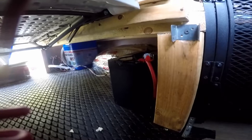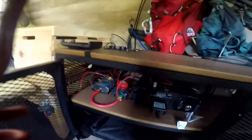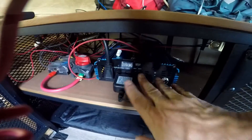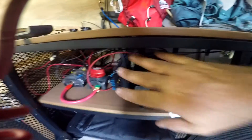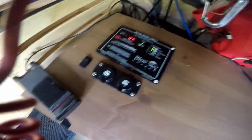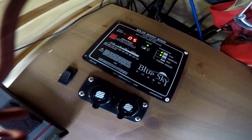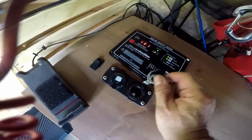This is my AGM 100 amp hour 12 volt battery — I just put it underneath the bed right there. It's a sealed lead battery, so I don't have to worry about any gases. All the wires come up behind here to the control panel. I've got my cutoff switch, my fuse box, and my 1500 watt inverter. I've got LED lights in the cabinet so I can see what I'm doing — a very simple install. That all runs into my Blue Sky solar charger, which is a 30 amp solar charger. And here are my 12 volt outlets.